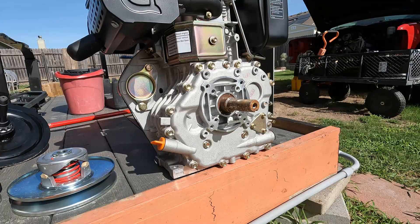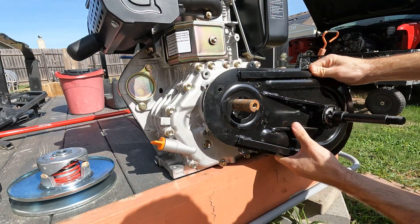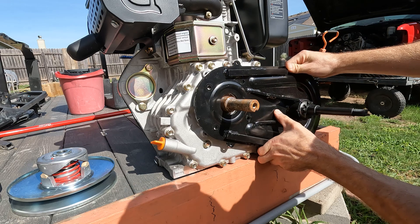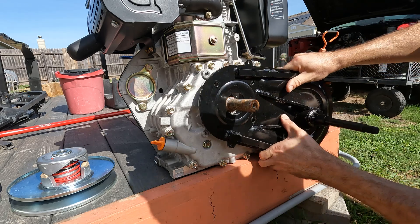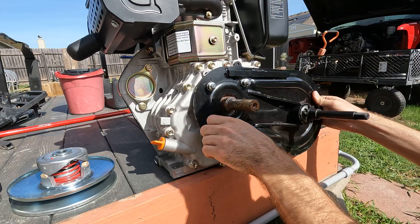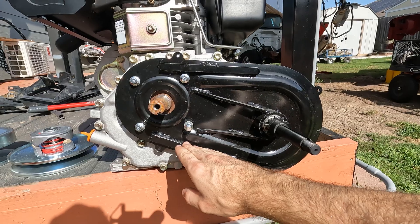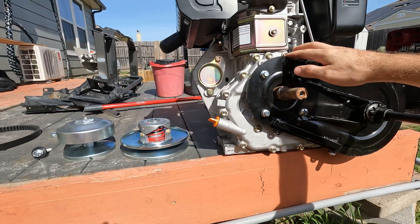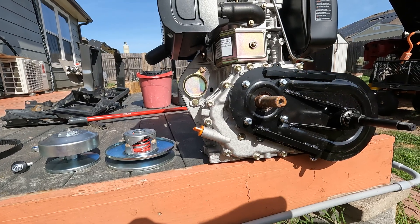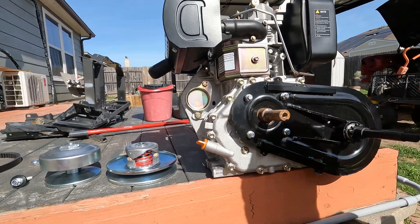The first thing we're going to do is put the backing plate on, so we need to make sure it has a bolt pattern that this can line up on. It actually looks like it does, so I'm going to go ahead and try to bolt this on and see how it fits. The torque converter is going to hang a little lower than the engine, so whatever I put this in I do have to account for that so it doesn't hit a frame rail or something. More than likely it's going to have a custom fabricated motor mounting system.